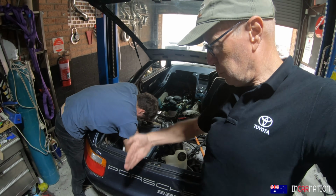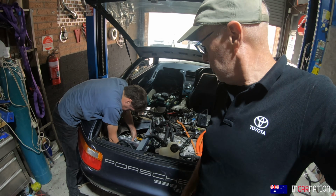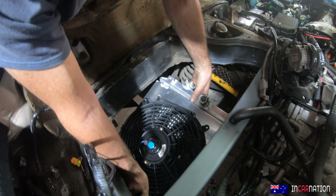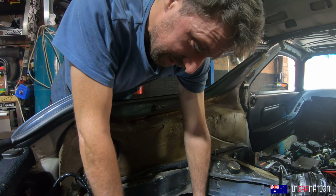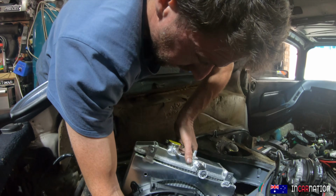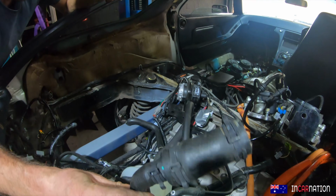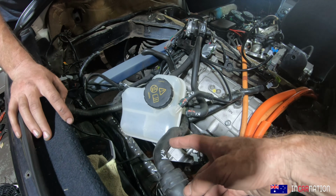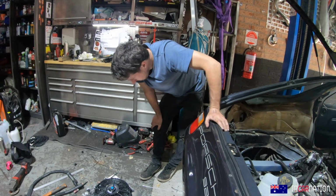I'd originally planned that the radiator would be straight, flush down, but Matt thought it looked a bit ugly sitting low, and if we ever do put a plate underneath it'd be too low, so just looking at options. That looks good too. Pushing air this way, it doesn't really. Yeah, it's got nowhere to go. It's trying to escape and it'll heat up this. Bearing in mind the whole system, it's not running very hot. It's not like a combustion engine car. The radiator the MG used was the same one they had for the petrol car, and it's complete overkill. See, that's the top hose. They've used that existing petrol radiator, and they said, "Oh, we don't need that. We'll just leave it down to just 18." So I don't think we're going to have a problem with overheating. We're already overdoing it.